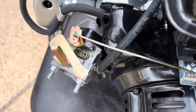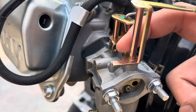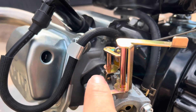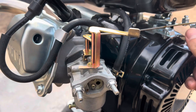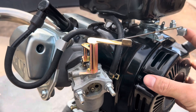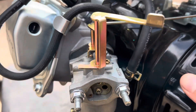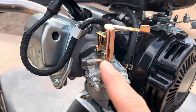When you do this bar over here — that little screw right there, you see how the metal touches the screw — you want to make sure the little metal piece underneath touches that screw all the way. That way when you put it in idle it won't mess up or start idling up on its own. Right there it's pretty tight. When you accelerate, it does open all the way. That screw — I believe that's your idle screw, it does control the carburetor.